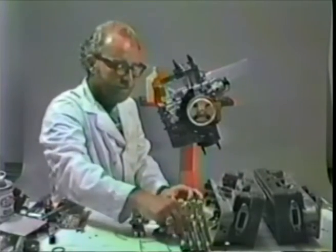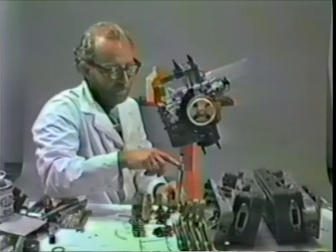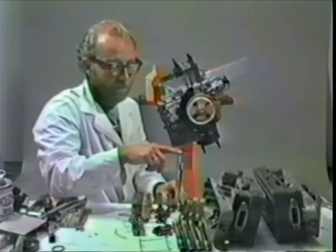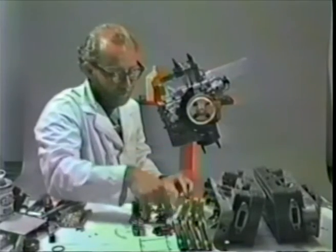We have 8 new pushrod tubes. Note the new ones have the 1-inch extension here that protrudes into the case side, not the head side. That's to prevent oil from slinging up into the head through the pushrod tubes as you go around a corner.